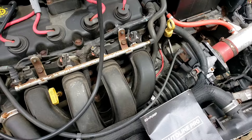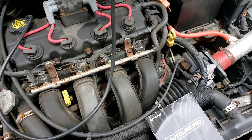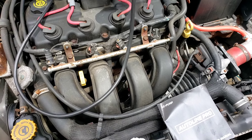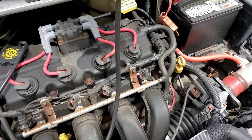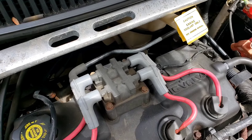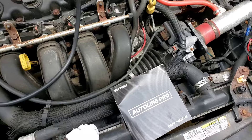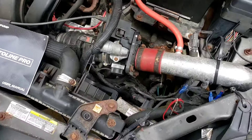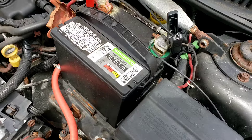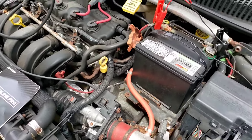This is a good thing because of all kinds of adapters — you could buy extra adapters. It's a good way to look for an exhaust leak, intake leak, vacuum leak. Alright, I'm gonna go walk around here and see if we see any smoke. Some might be underneath the car, some might be in the back by the purge valves. I'm gonna get a flashlight so I could find a leak for you guys.